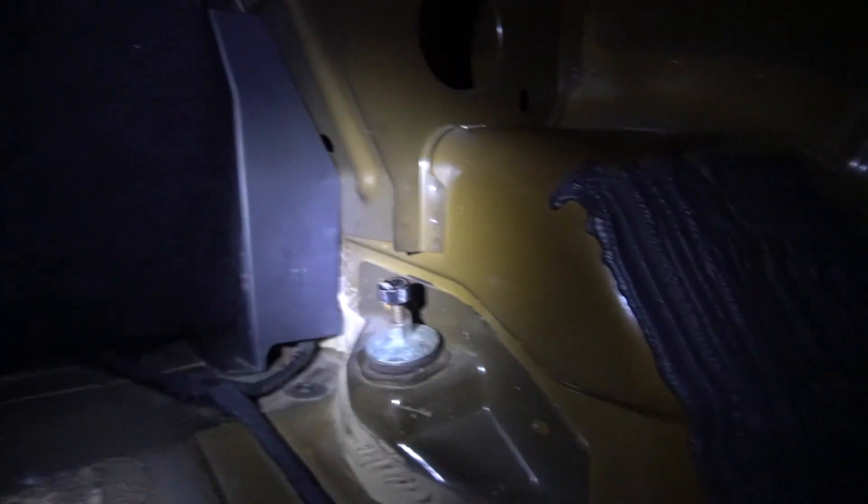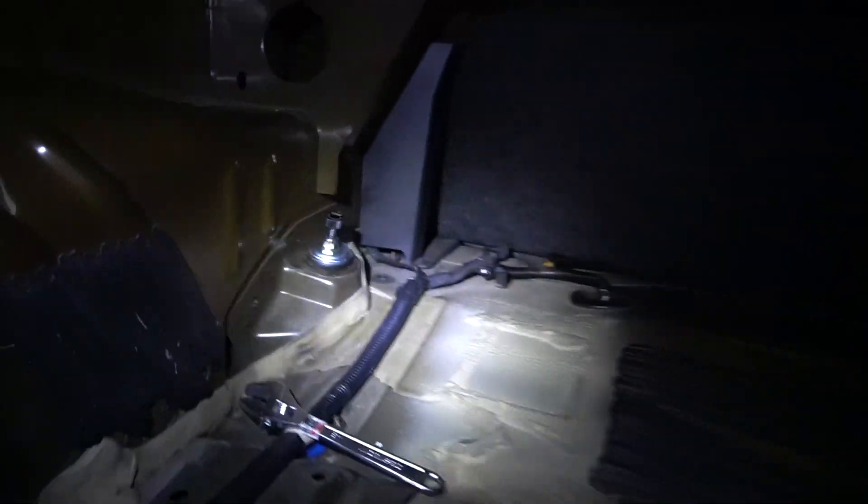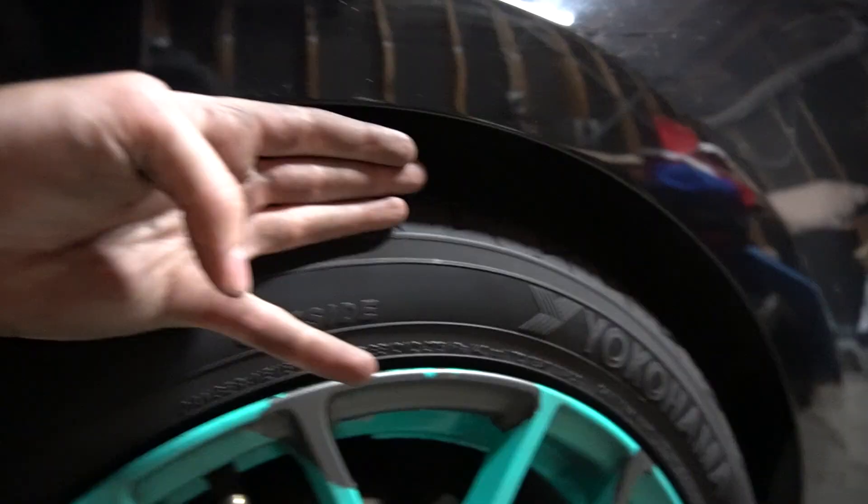Yep, that looks right — compare it to that side and it looks good enough. So if you have a Mustang S197 and you have BC coilovers, I still haven't found a better solution than this. You just use washers — it seems really poorly executed. The only way to get the bottom bushing and washer is to buy new struts, which obviously you don't want to do. It's kind of dumb that BC Racing doesn't even make the bushing separately. For reference, it's about three fingers to the top line on one side and about three and a half to four on the other — this side is still a little higher. I don't know if I need to let it settle.